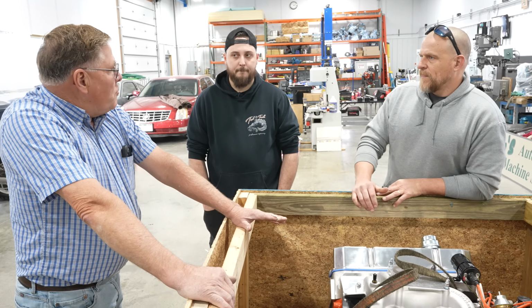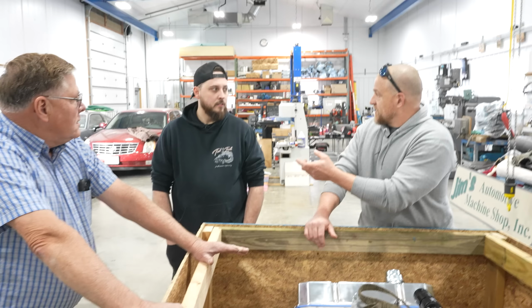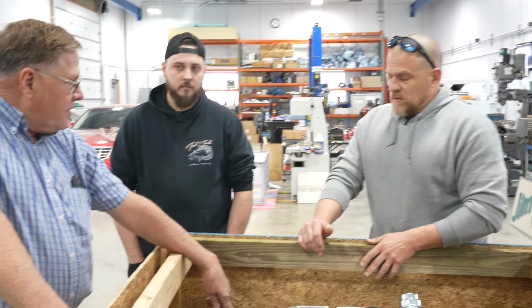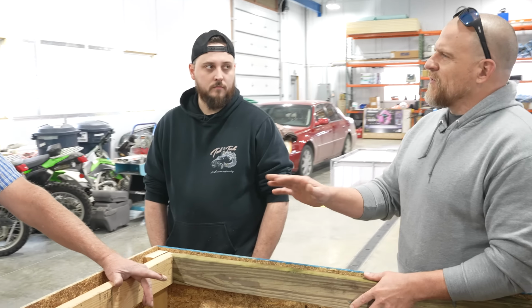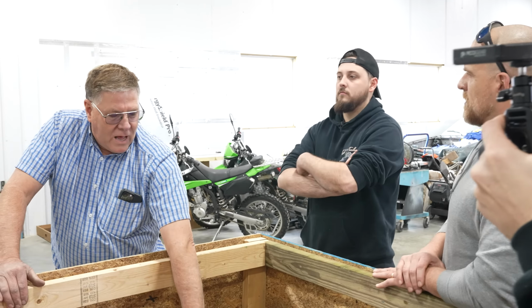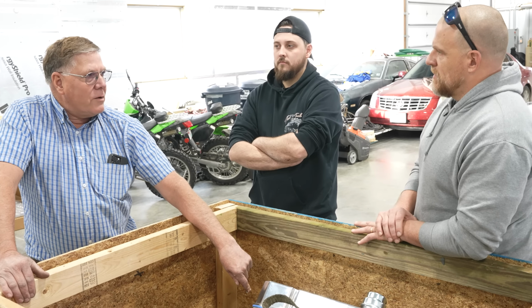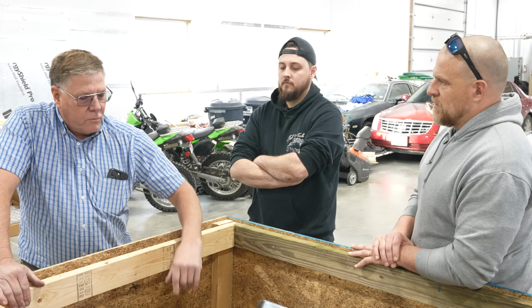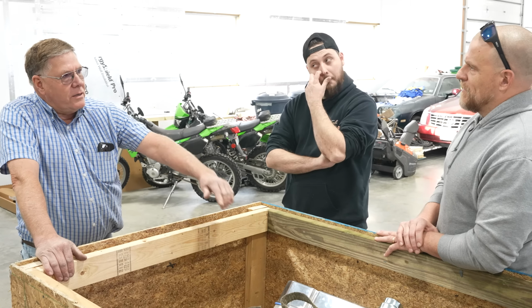The engine you started with was a very low mileage, pretty nice engine until it got left sitting out and got water in the cylinders. And you said that when you pulled the bearings, they were stamped 72, and that's what I was told. Then these heads, they're not original. I knew that because the industrial motor had different heads. That's what I kind of wondered, if this block didn't have the industrial heads on it that went away somewhere. I think that's the case, and then these heads got put on, but these heads are rough. Really rough. But your short block was really, really nice, with the exception that it had sat out and got water down the cylinders. The pistons were factory, the bearings were all factory, so like you said, not a lot of runtime on it.